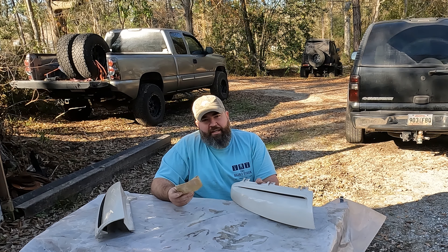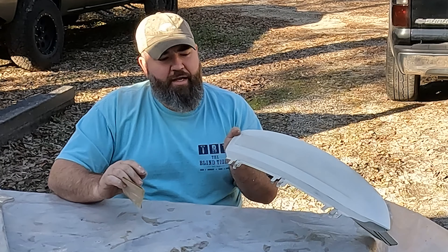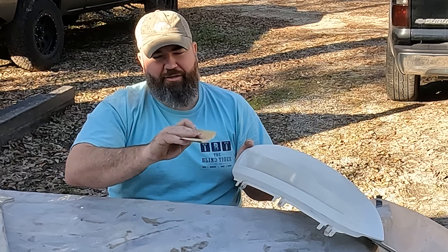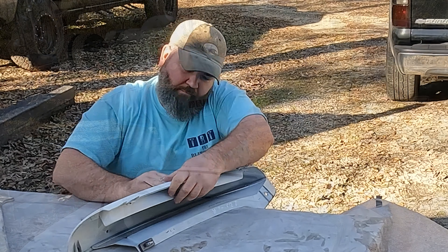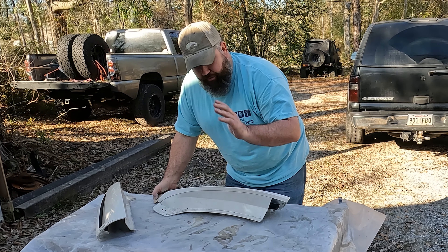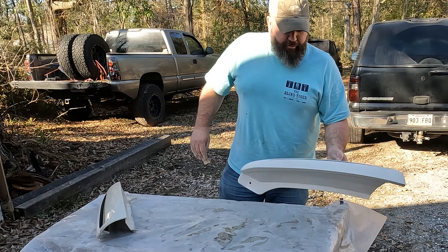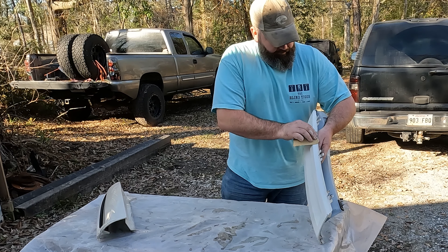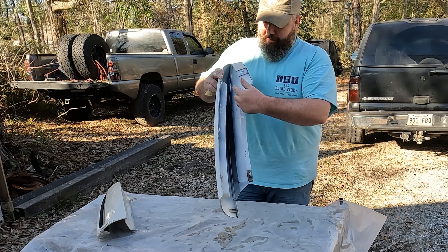I'm just trying to give some grooves for the new paint to sit into. The paint I used is Rust-Oleum paint primer in one — it's thick, so you won't see any of these grooves at all even with 220 grit paper. What you don't want to do when sanding is go over the hard creases — you want to leave that nice crisp line. Just avoid those and hit your flat areas nice and good. You'll see this part too whenever the hatch gets opened, so I'm gonna paint in here also. That's all the parts you'll see through this little vent and the back piece.